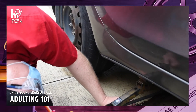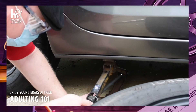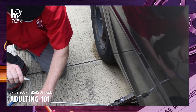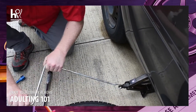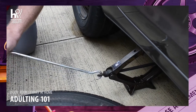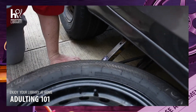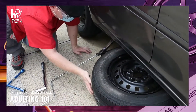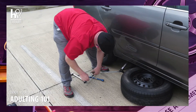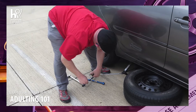Once you've centered the jack underneath the lift point, you can begin to raise it into position. I'm doing this manually without the jack handle because there's not much resistance on the jack at this point. Once the jack is touching the frame, I hook my jack handle into the jack and begin to tighten the screw that drives the jack — righty-tighty, lefty-loosy; right is going to lift my car. I do not lift the car fully off the ground because I need the wheel in contact with the ground to hold it in place while I loosen the lug nuts. The jack in your car is an emergency device — it is not designed to support your car for an extended period of time. You should always put something underneath your car to catch it in case it falls. Here, I'm using the spare tire.